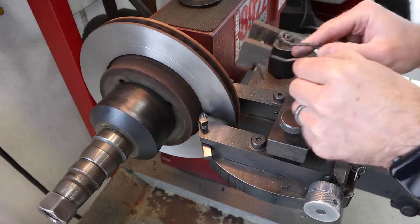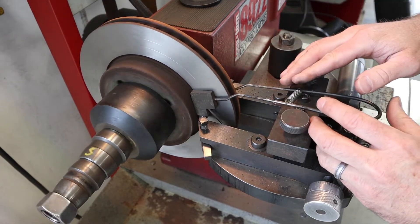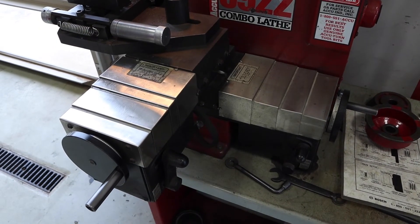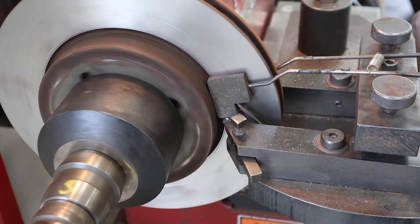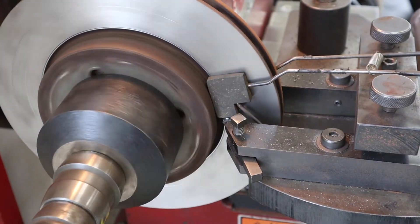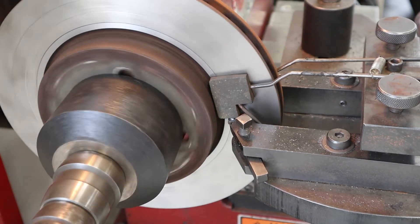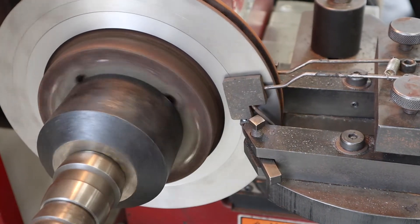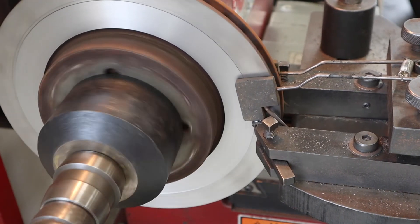With both sides locked in, set the silencer — it sits on top of the tool heads and the spring holds it in place. Then engage the auto feed. Once that's clicked on, the axis for cutting the rotor slowly feeds backward, and we just sit and wait while the machine cuts the full face of the rotor. This is sped up about 2000% — it does take some time but is somewhat automated, so you can walk away and come back when it finishes.